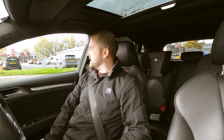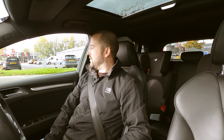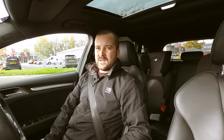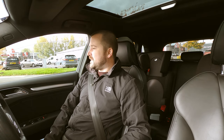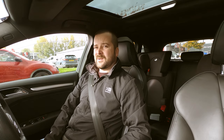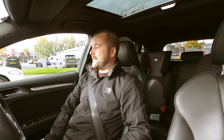Now, personally I'd imagine it's going to be a bit of a restriction. But the turbo we're putting on is rated to about 530. I've seen people at 550 with meth injection, but we're not having meth injection, well, not yet anyway. So I reckon with the stock cat back, we can just creep over 500 horsepower. But we'll see, I guess.